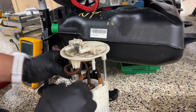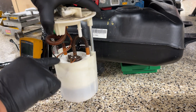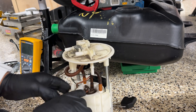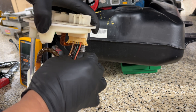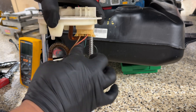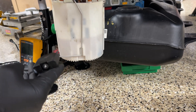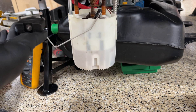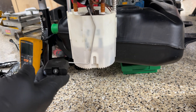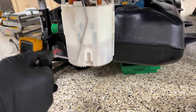When I check the motor here — this pump assembly is made up of two parts: your float and your pump motor. There's four wires; the two outer thicker-gauge ones are your pump motor, the two inner ones are your float. The float is basically a potentiometer — when the tank is empty it's 650 ohms, when the tank is full it's 110 ohms. As the resistance varies depending on where the tank is at, that's what tells your gas gauge full to empty.